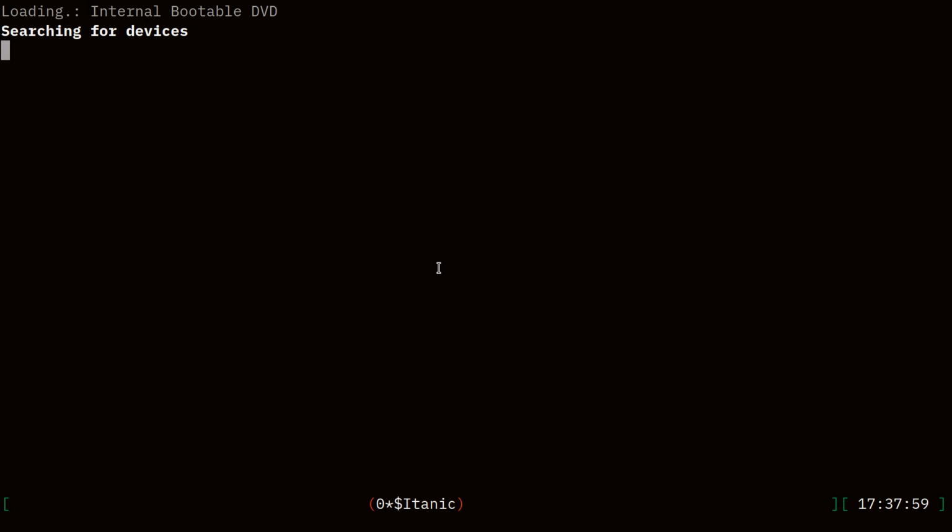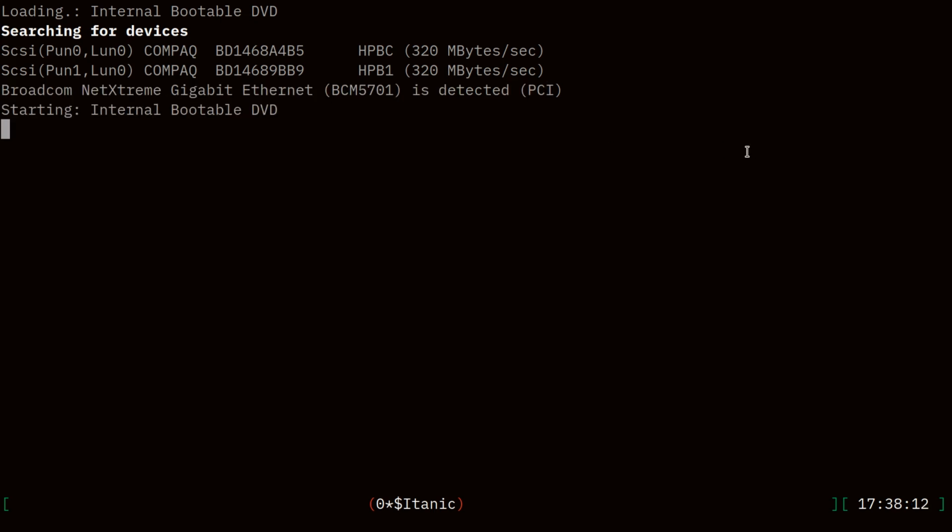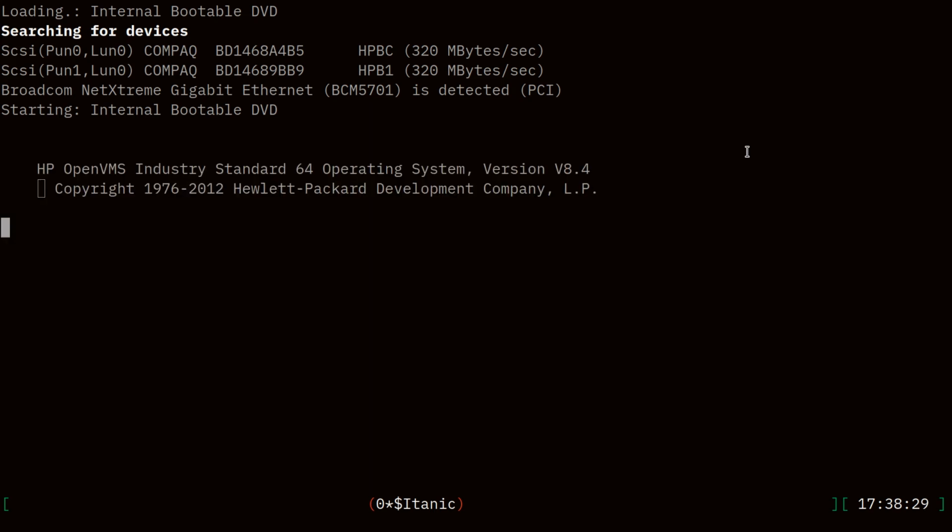You'll come to find that most things on the system feel pretty slow. The hard drives are, we have two Ultra 320 SCSI hard drives, which was the standard fast hard drive for the time, the era when these servers were new. So despite being 10,000 RPM drives, they are still just Ultra 320 SCSI, which by today's standards just feels really, really slow for most I/O operations.